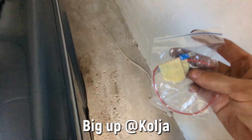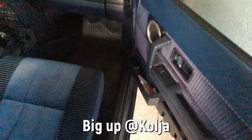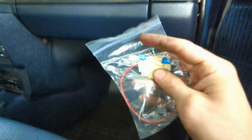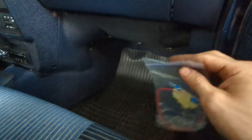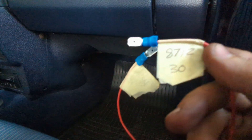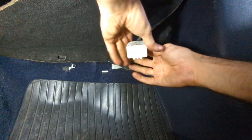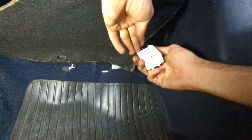I keep this little wire in the back of the car to jump the fuel injector relay — a common failure point on these cars as most of you know. This wire does the same job: it bypasses the relay. It's a nice way to test manually whether your pumps are working. We're going to plug it on and you'll see what it does — it runs the pumps manually, does what the relay would do.